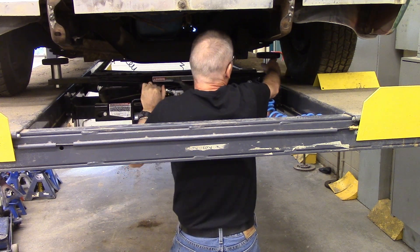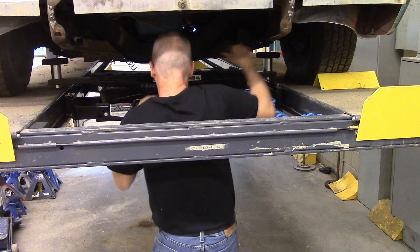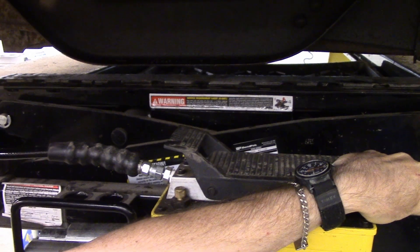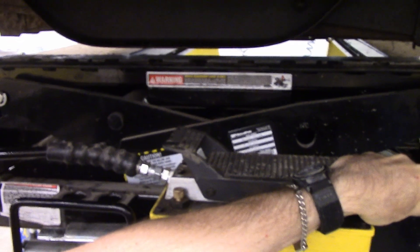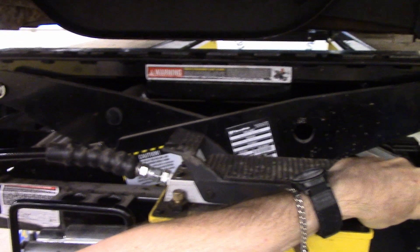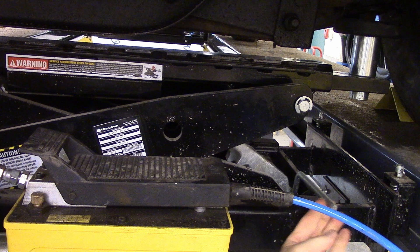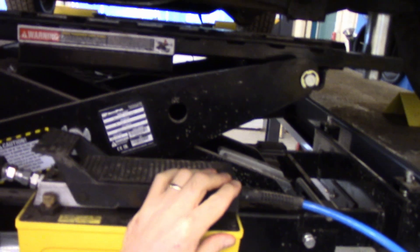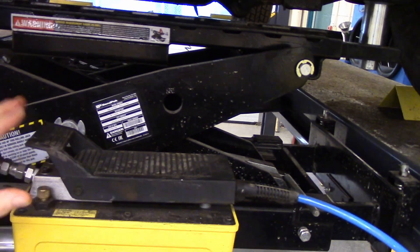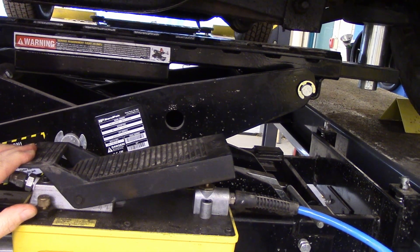Get me to check your placement before you lift the vehicle. Once those arms are where you want them to be, extend it out and positioned, you're going to push this end and it'll start to raise the trolley jack. It will click past locks just like you heard the hoist itself. This is the lock on the side here. Once that thing falls and locks into place — click — now you can lower everything onto the locks.